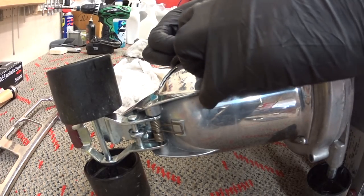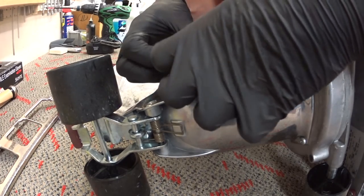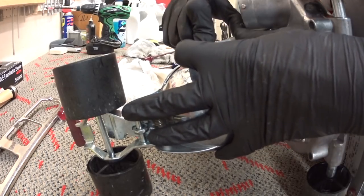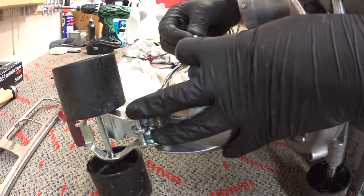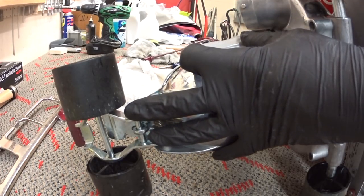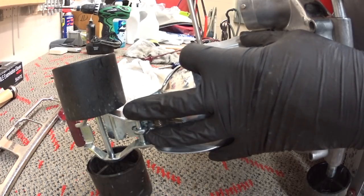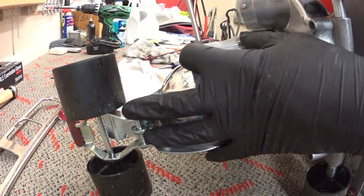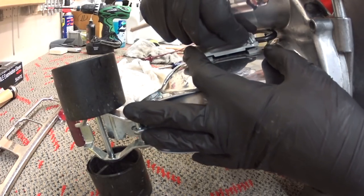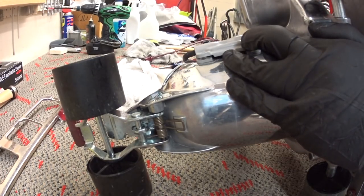All right. And then this little funny clamp cover thing, I always thought was a little Mickey Mouse and weird. This goes on with the longer screws now. And you do not torque this to gorilla tight. You torque this just very lightly. You don't want to break something. Again, you notice it's an old school design and it's cast aluminum. It is actually kind of fragile in a lot of ways.